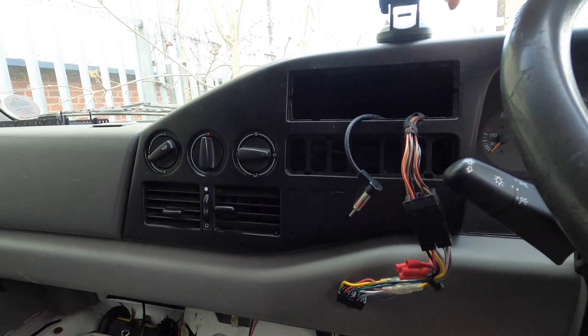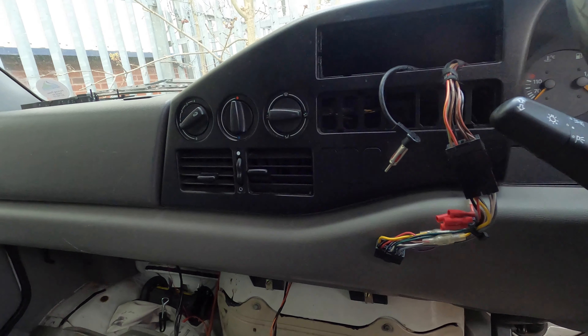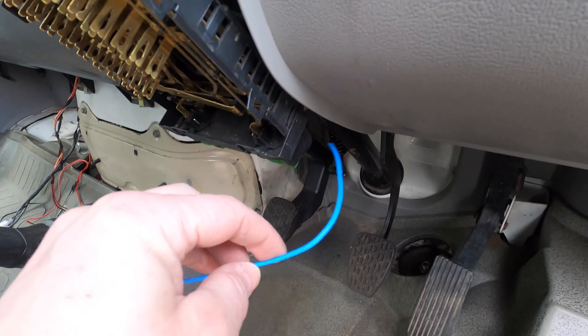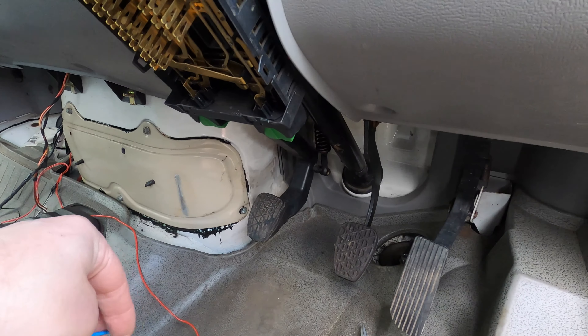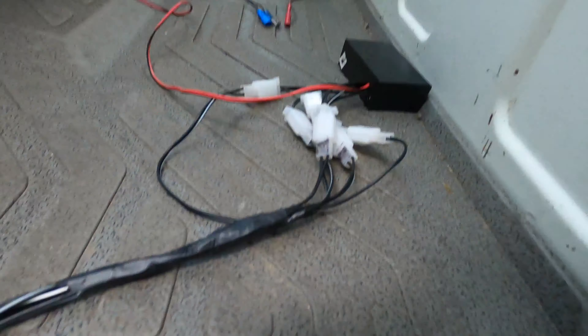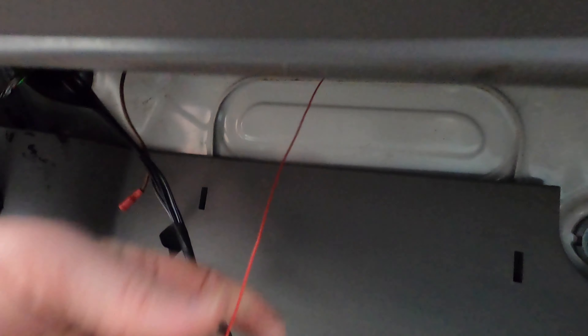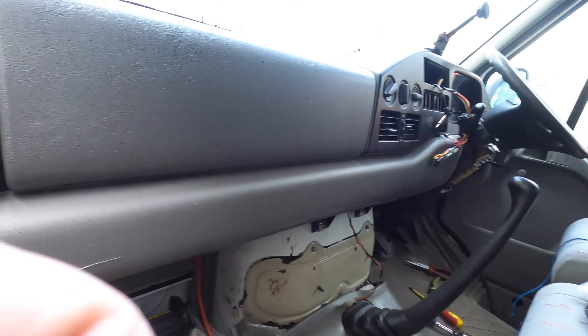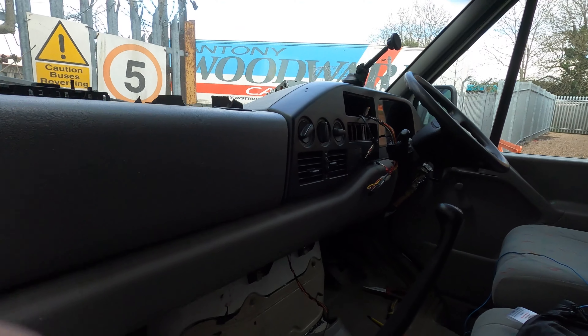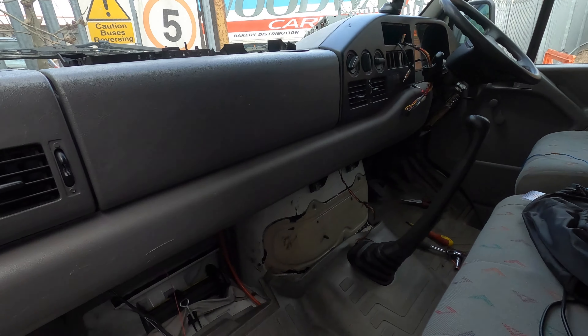With that problem solved, I removed all the wires from behind the dash, replaced the trim panel that housed the fog light switch, safely disconnected the wires that went into the back of the fuse board, and followed the control box wires to get rid of all of those that went into the engine bay. That wire actually goes to this earth — that whole wire, leaning all the way across, going all the way up there, going to the back of that section for that switch, was just for an earth.